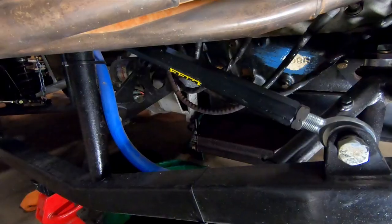So we're going to go ahead - I need to change the oil in this thing. We'll dump the oil, I've got to put a new filter on it. The seal behind the drain plug in the transmission has been leaking, so we're going to replace that too, and then fill her up with eight new quarts of VR1. Let's get to it.